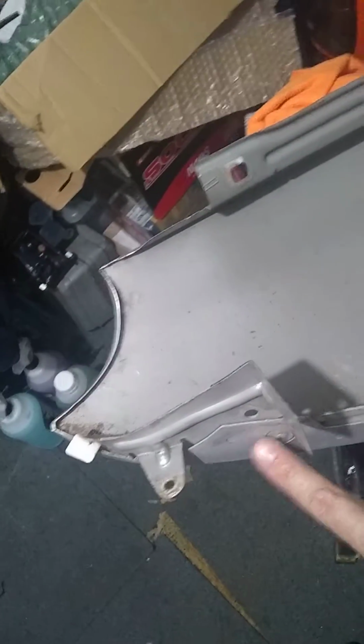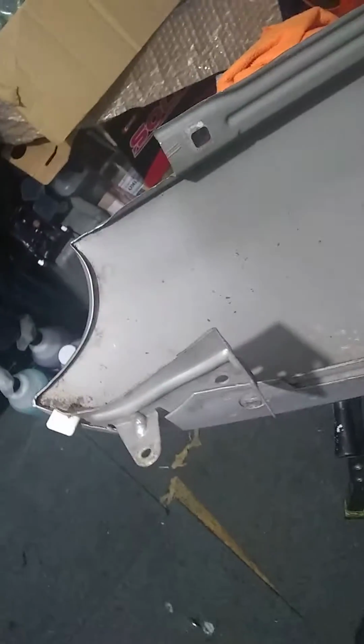Plan will be that I clean all this back, completely Hammerite the whole lot inside, including here, and I'll do part of this as well actually, because you won't see this. So I'll make sure this is all completely sealed, everything. Once that's dry, I'll probably go belt and braces and throw a load of wax on top as well, just to keep it good.